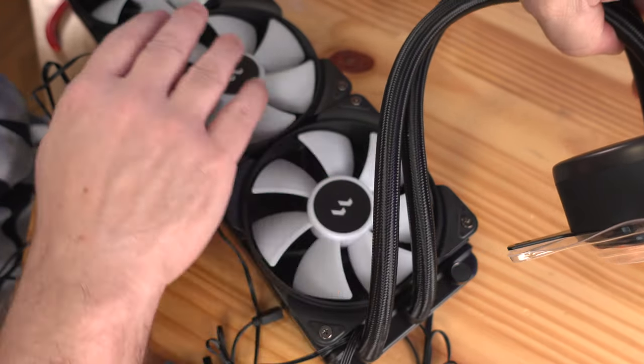You'll notice a little C-shaped thing here that sticks out, and there's a screw hole here. We're going to align the screw right into here and then screw it in — don't screw it all the way, just so that it sticks there. Do the same on the other side. Before we put the pump in, insert the ARGB cable end into here — you'll hear a tiny click when it's completely inserted.